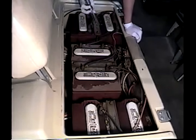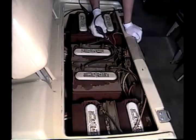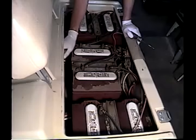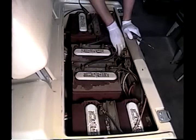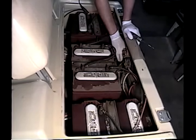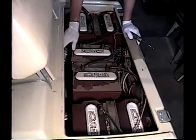One of the first things you'll notice is if you attempt to test the charging receptacle, on a 48-volt Club Car there is no negative current at the charge receptacle. It's governed by the computer, which is under here — and that's different than the controller. So the computer does not allow negative current to be present at the charge receptacle. So when you're attempting to charge the car, if for some reason it will not charge and it's not a mechanical problem like a broken wire, the problem is probably in the computer.